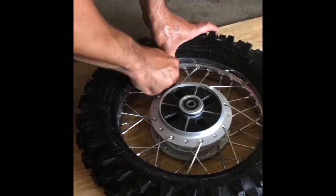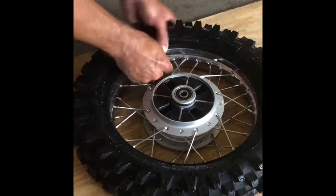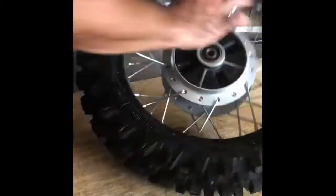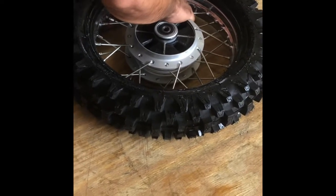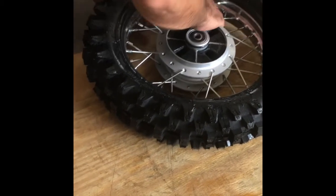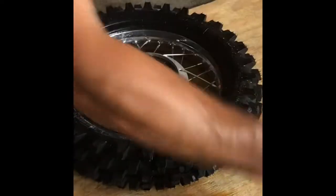What we want to do is put our nut on about three quarters of the way on that valve stem. You want this thing to be about three quarters of the way tight — that way when you're putting the rest of the rim on you won't pinch the tube. It'll stay in place and won't move around on you and try to come out of that hole. You don't have to tighten it all the way down — just finger tight. So now we're going to go ahead and lube that rim up a little bit more with some soap and water, and get the rest of the tire started.